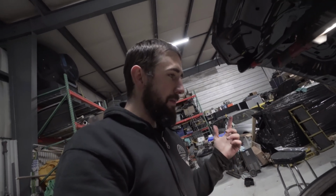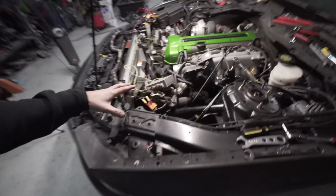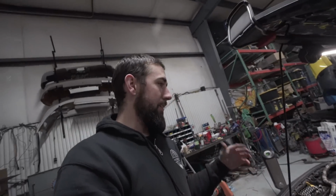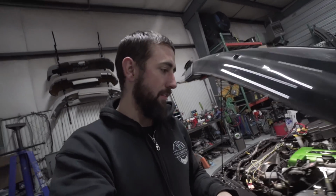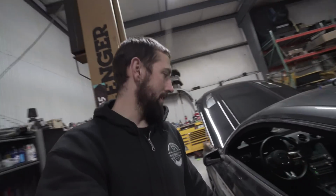Maybe there's a different wire, or maybe that thing might have like 3 coolant temp sensors on it. So coolant temp's not working right now, but I did just start it. I got the base fuel pressure and everything all set. So excuse this whole mess. This is obviously just to test everything, make sure it all runs, make sure there's no leaks in the fuel system, make sure that the throttle works. There's no coolant in it right now. I did hook up the downpipe so it's not making a big old stinky mess in the engine bay, which, you know, it's still making it in the whole shop. But check this out.